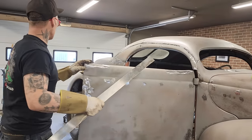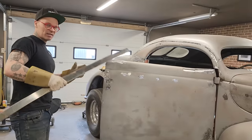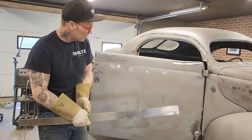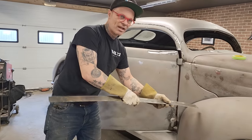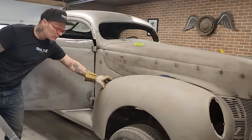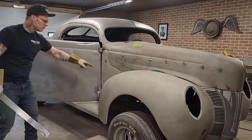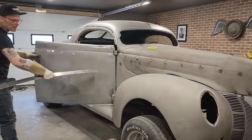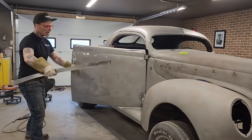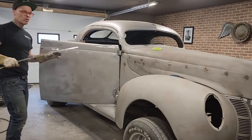That's because at the end, when I have it all welded up, that's when I like to sandblast things, because it makes the material scratched up and pitted up, ready for primer, body filler, fiberglass, anything you want to do to it. That sandblasting, to me, preps that metal for anything that you want. For me to go over and sand the whole car, when I can sandblast it and get it ready that way, that's the way I'd rather do it.